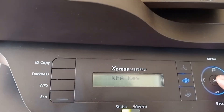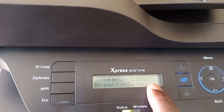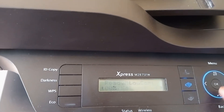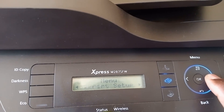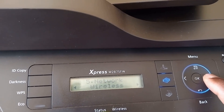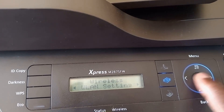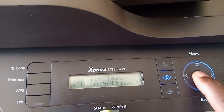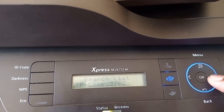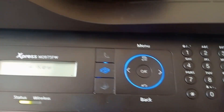On the Wi-Fi key, leave WPA — go back. This is the Wi-Fi name; if you search the list it will give you the available networks. Go to Menu, press the arrow key to Network, say OK, then Wireless Network, OK, Wi-Fi on, skip that. Select Wireless, click OK, then Wizard — say OK. It's searching now. It found networks; I scroll until I get the one I want, say OK, and it's asking for the key.